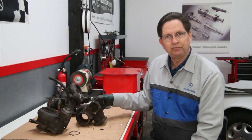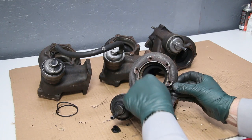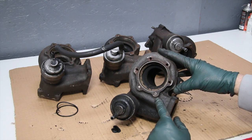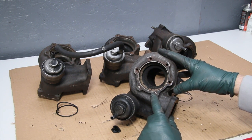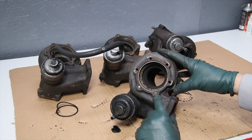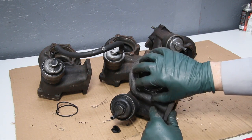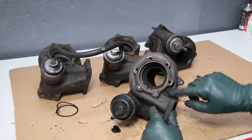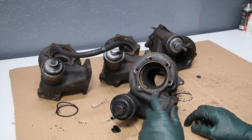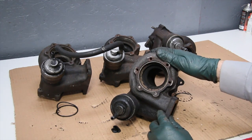Here you can see a close-up of the turbine housing. The turbine wheel fits right in here, and hot exhaust gases from the engine enter here and spin the wheel. Notice there's a problem — look at these two broken-off bolts. This is very common on these as they age. The bolts get rusted in, and it's very difficult to tap them out and get the threads correct. Sometimes if you break off one or more of these bolts when removing the turbine center section, I recommend you get a replacement housing.